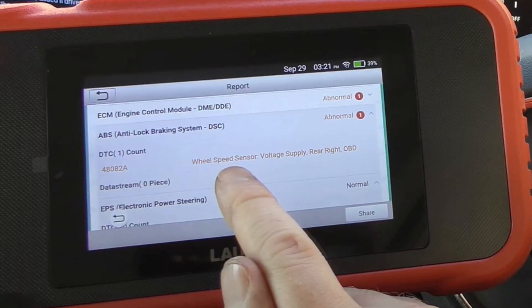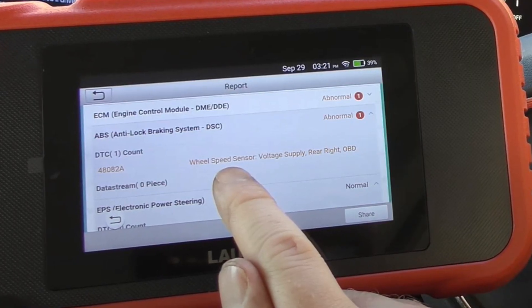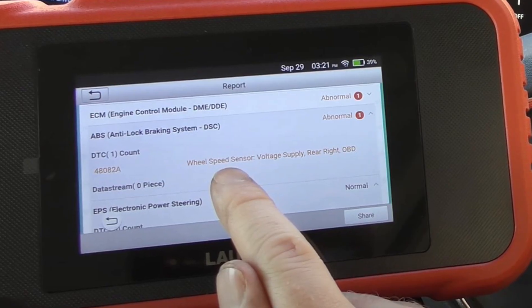The second scenario is when you randomly see this warning, especially when you are driving slowly, and it doesn't matter if the road is good or not. In this case, I suggest you get a good scanner and read the ABS sensor readings in real time when you're driving. The most common culprit that can trigger the all-wheel drive overheated warning is one of the rear ABS sensors failing — it sends wrong readings to the computer and the system thinks that a certain wheel is slipping.